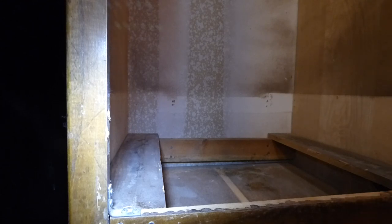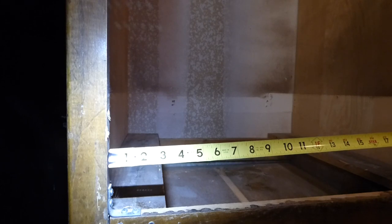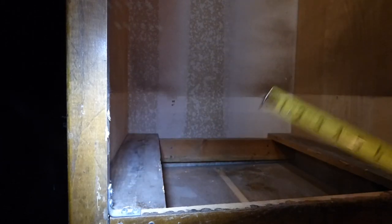There might be one little bitty part to do, and that is with the sides. This is across here around about 24 and 3/4 inches, I think at the top it's more like almost 24. This cabinet has a little bit of issues on the bottom. So I'm just going to go ahead and try to put this thing in there and see if it fits, or if the cutout is the real cutout. I think they asked for about 24 and 7/8 minimum to like 25 and a quarter. I'll get back to you.